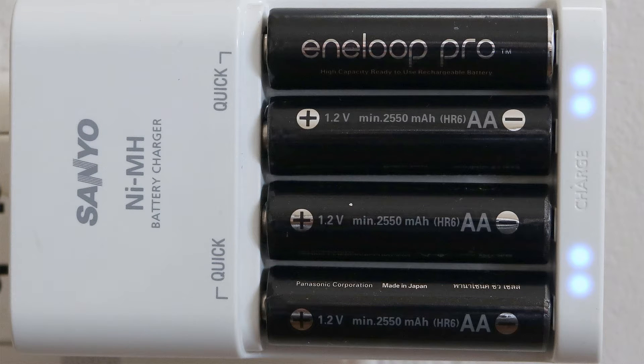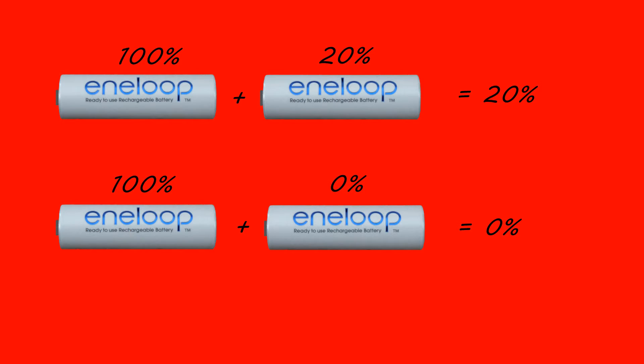Just recently I've run into some problems because with time and use rechargeable batteries degrade and there's no way of knowing. At first I just used a very basic battery charger — there's a blue light that comes on when charging and goes off when finished, but there's no way of knowing anything about the battery's condition. The energy performance of a device is limited to the performance of the weakest battery, so if you have a device with four batteries and three are running at 100% and one is running at 20%, the overall performance is only 20%, and if one battery is completely dead the device won't work — and I experienced this quite recently.